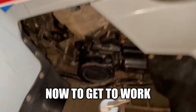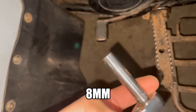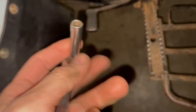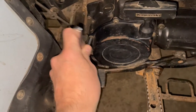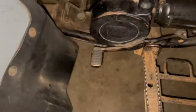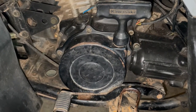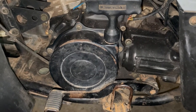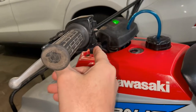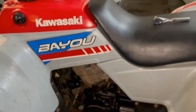Today I'm going to change out the starter clutch, and it looks like we're starting with an 8mm. These are fairly loose to begin with. I started them already, so I'll pull this pull start off first. This is the Kawasaki Bayou 220, KLF 220 — two wheel drive, four stroke, shaft drive. The starter is acting up; I assume it's the clutch inside there, and I'll need to replace the clutch and gasket.